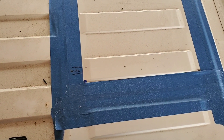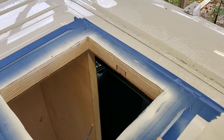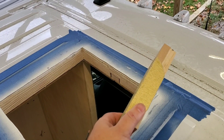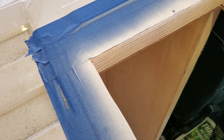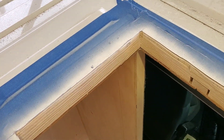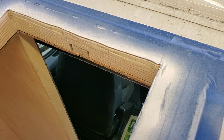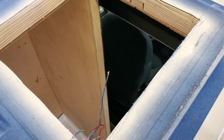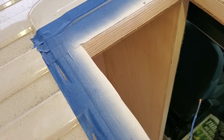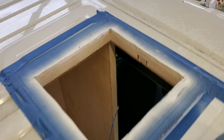So let me get this cut open. After I get it cut out, I always take a good solid block of wood and some sandpaper and knock all the burrs off the metal all the way around. Then I'll put a couple coats of spray paint on it just to keep it from rusting while I've still got it taped up. That way you don't have to worry about getting anything on the paint on the body — just on the raw edge of the metal. I'll let that dry and then we'll get the fan installed.